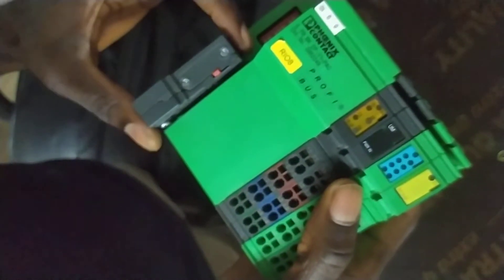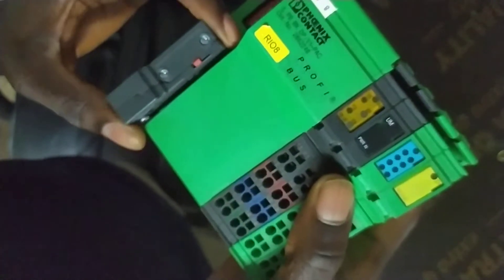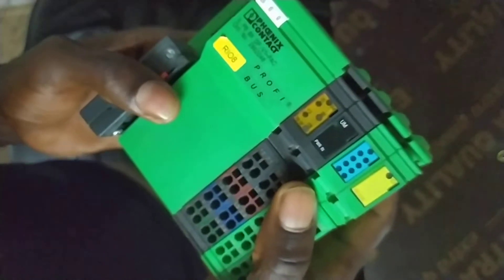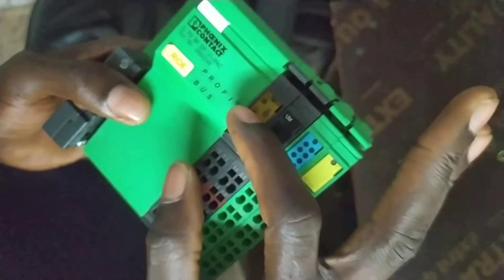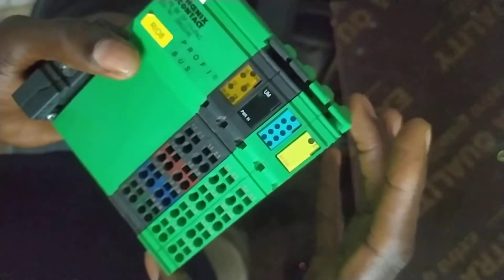When you find the red light blinking, first check your Profibus switching and the unit. If it's fine, okay. If it's not fine, try to replace it and fix it. Now if you replace and fix it but the error does not clear and you still have red light coming on, that means one of the units is bad.